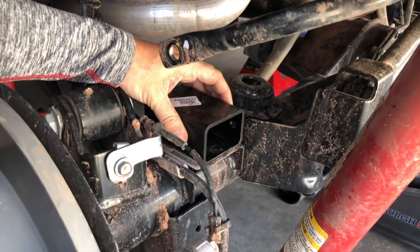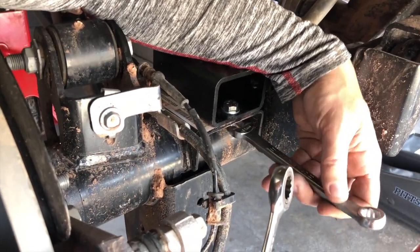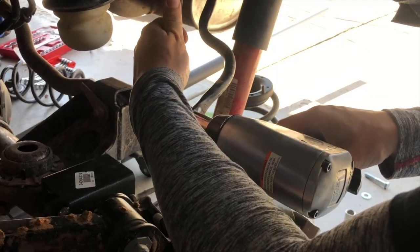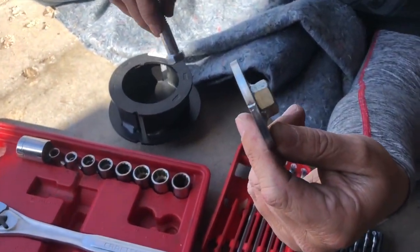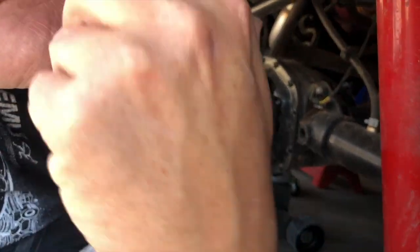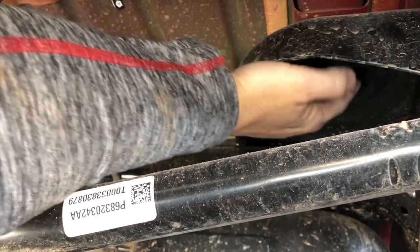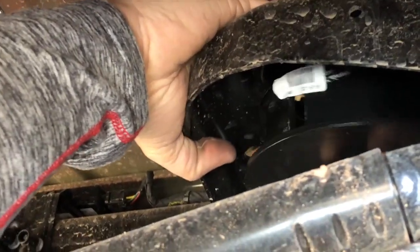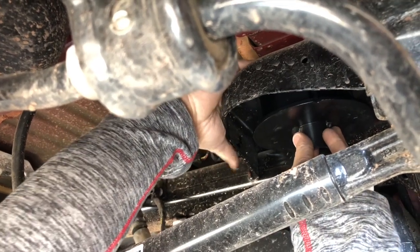The springs will come out like so. This is the bump stop spacer — it's going to go right here. There are two holes right here on the frame on the bracket. Drop the bolt in from the top. You need two open-ended wrenches to be able to get into these. You're installing the upper portion of your sway bar link first. The next step is installing the coil spring spacer washer and the actual coil spring spacer itself. The design of this is interesting to say the least. We're going to do this nut side up, washer side down, and it's going to go above where the spring sits and sit perfectly flush in this cup on the top side of that mount. Drop your bolt in here, reach over the top — this is literally just by feel. It'll center once you tighten it down.